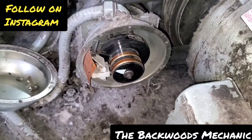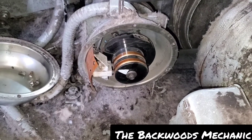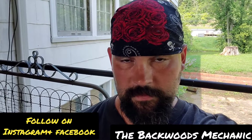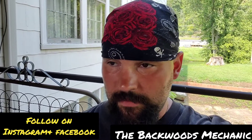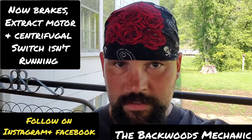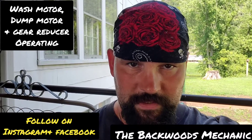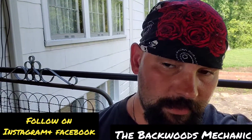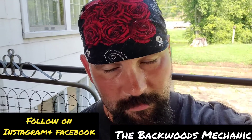Ring number one is reading 120, number two as well — as far as that part goes it's fine. Usually those little carbon brushes will burn out and you have to replace them, or you'll need to clean the outside of those rings, or replace the switch itself. The whole reason I checked this first is that I came straight in and they already told me some of the symptoms. They said the motor wasn't running — it was running the day before, but the brakes weren't stopping it. Then today when I got there the thing wasn't running at all. We turned it on — wash motor, dump motor, and gear reducer all three running — but the back motor, the main extract motor, was not running. Some of these machines have a high-speed extract motor, a low-speed extract motor, and a centrifugal switch. The centrifugal switch was reading voltage and functioning fine, so that was minimum possibility for the problem.